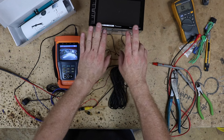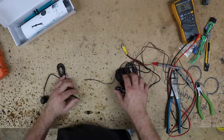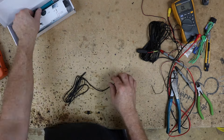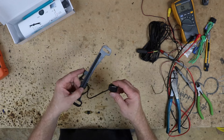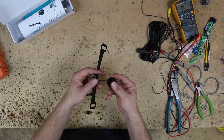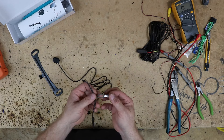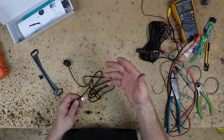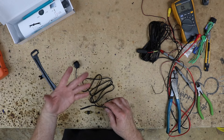Because the radio is going to do two things: switch over to the camera when in reverse, and also allow you to switch to the menu and see the camera when it's not in reverse. A couple things about this camera specifically since we're using it for this demo. It's designed to mount under a license plate — you can have a license plate frame, slide this on, and the camera attaches with two screws. That way you can have your custom license plate and a backup camera without getting in the way. On the camera harness, there's a loop — if you do not want the parking lines, cut this loop and they'll go away. If you're using a radio with adjustable backup lines, cut this to disable the built-in parking lines so you won't have two sets.